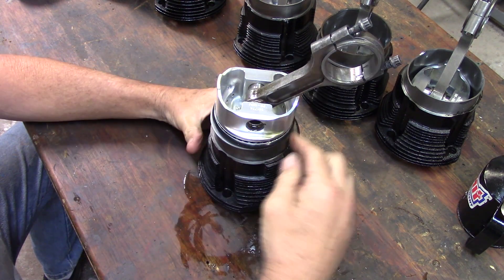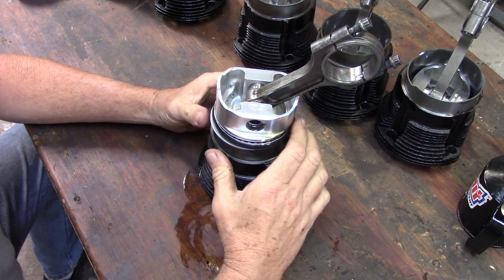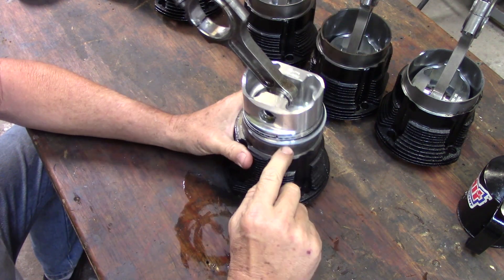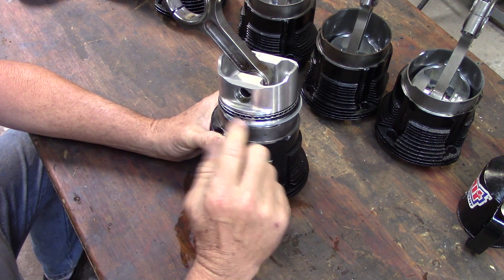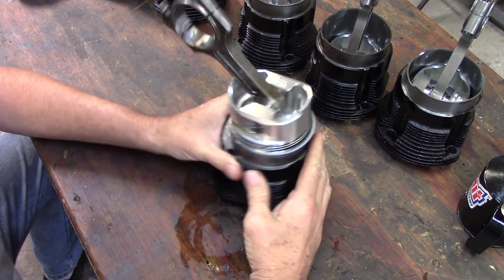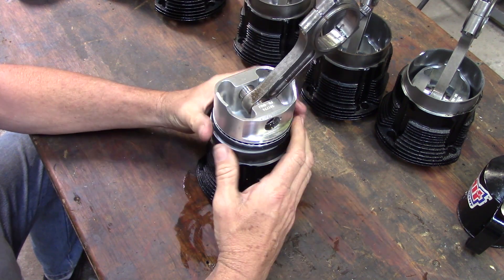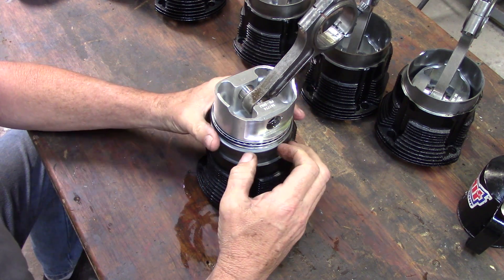You are looking at a piston entering the bore from the bottom. It has a chamfer on it. You have to watch the slot over here, where it is ground, so that it has clearance for the opposing rod. But if you take a look at it, you can actually insert, using only one small hand tool, the piston into the bore and the rings down into the engine.